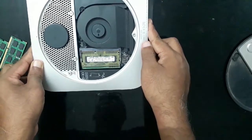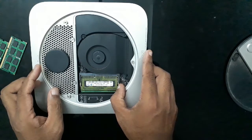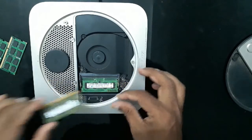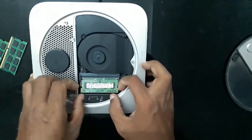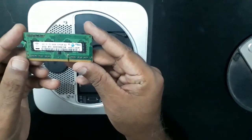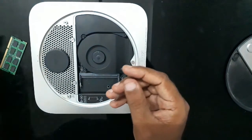These are the two RAM sticks of 1 GB each. I'm going to put my finger here and push it out to the side a little, and the other side also, so it just pops out — it's spring-loaded. Wiggle it slightly and take it out, then do the same with the other one. Push it outwards so it pops out. This was my old 1 gig RAM — it says made in China, Samsung, but made in China.